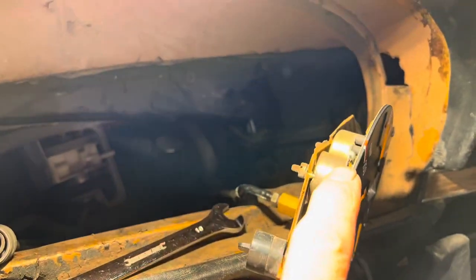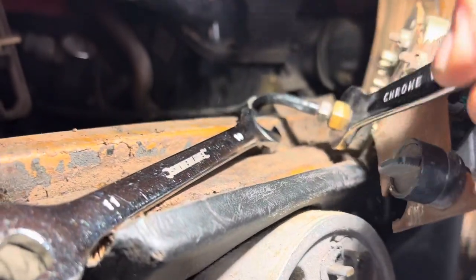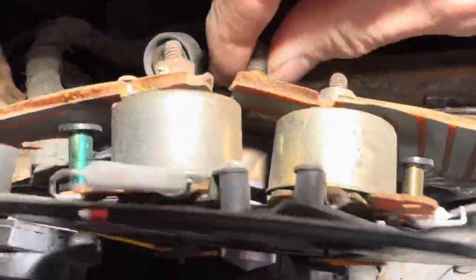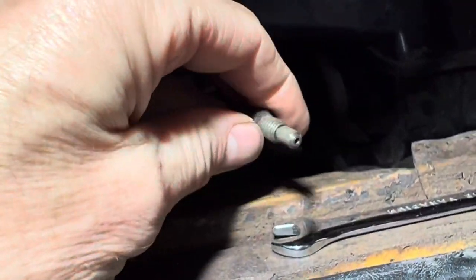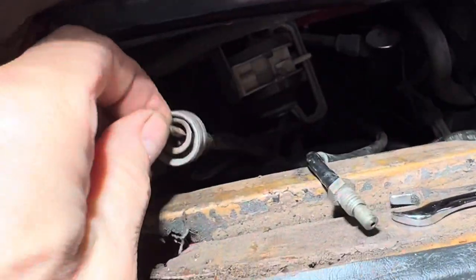If you need to take your instrument cluster out, it's important to do this with two spanners — a 10mm spanner to hold the small nut and a 13mm spanner to hold this. Once you've cracked that nut you should find you can use your hands to undo the rest. That is the oil pressure line and there's a good chance it'll have oil in it when you take it out, so make sure you've got a rag or something to plug that with when you take it off.